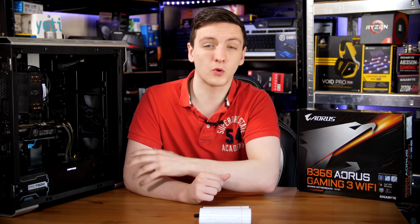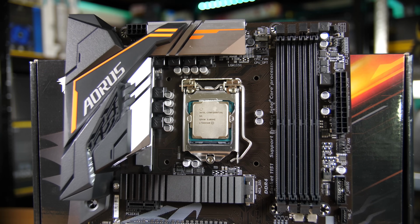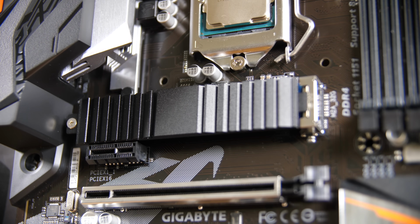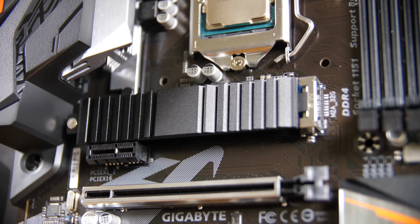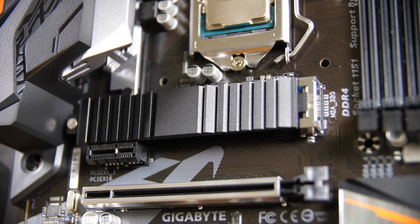As you should expect with a motherboard that only supports Intel's 8th generation Coffee Lake CPUs, it uses an LGA 1151 socket. You also have 4 DDR4 RAM DIMM slots available to you, which is actually quite nice, even though this is a relatively slim ATX board. You also have a heat-sinked M.2 slot just below the CPU socket, which, while blocked from the airflow path by the RAM DIMM slots, should still have pretty decent thermals if you have a CPU air cooler, since the heatsink that covers it is fairly thick, has a nice thermal pad on the bottom, and has a little bit of heat-sinking design.